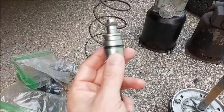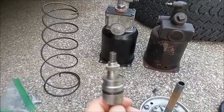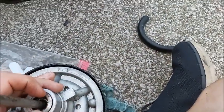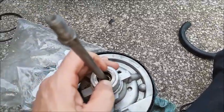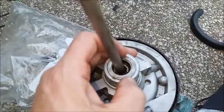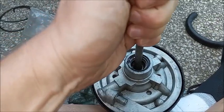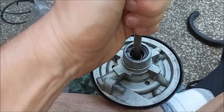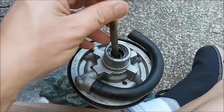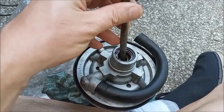And also put the O-ring back on the air valve. And now with the spring in the end, ready to put it into the bottom of the piston. And once it's in there, add the washer to push in a little bit on it, and the triangular ring, except in our case it's going to be the two snap rings. And now with the snap rings in place, you can see how the push rod pushes in a little bit. First little bit is to close off the atmosphere, and the second little bit is to open the vacuum. Vacuum hose, in this case with no clamp, but got to consider that for reality.